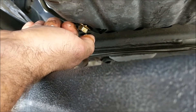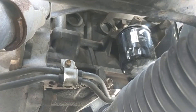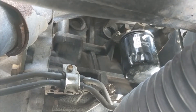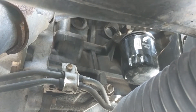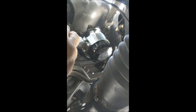Don't over-tighten it or you could damage your oil pan. Next, locate your oil filter. On my 1999 Toyota Tacoma 2.4 liter, the easiest access to the oil filter is from the passenger side, just next to the front right wheel. Go ahead and install your oil filter wrench on the oil filter and turn it counterclockwise to remove it. Make sure you have your oil drain pan underneath to catch any oil that falls.